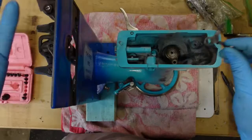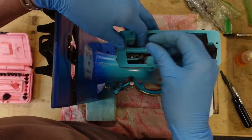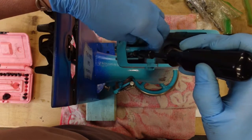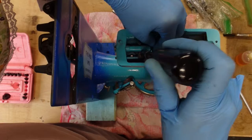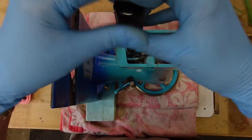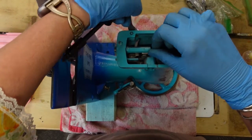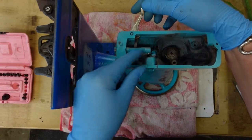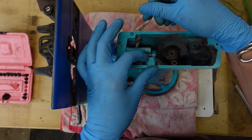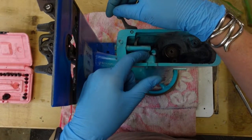Starting from the inside, I'm putting this little bracket in here — it slides underneath everything. There's a lovely little screw that goes with it. I have to slide it from the bottom and put the screw in through the hole because it's too big to put in between all of these. I've got it wiggled in place. So when this presser foot lifter comes up, this is going to get pushed over here towards the tension mechanism chamber — jerk! like that — and then it'll get pushed back by the spring, pushing the pin backwards.